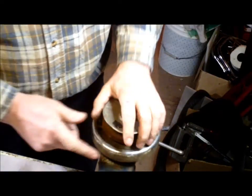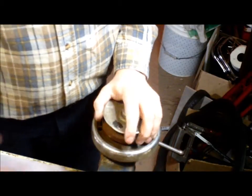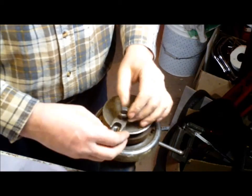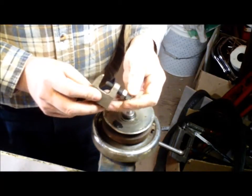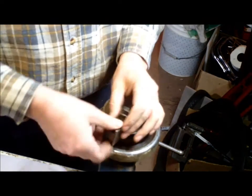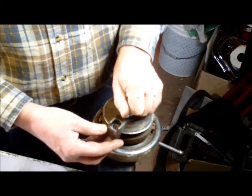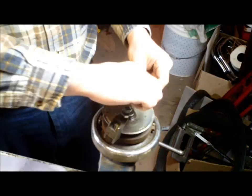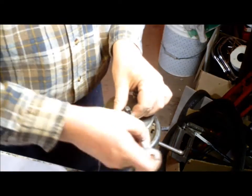Next is to get the fixed cheek for the pulley off. You can put a strap wrench around it and really, really haul on it hard, and that'll do it. I have these wonderful little clamps here — they're clamps to hold strapping to beams in industrial warehouses where you're not allowed to drill through the hardened steel beams. They work out just dandy — put one on each side, and that's going to hold this little bugger pretty darn still.